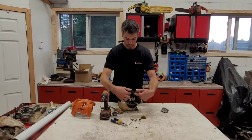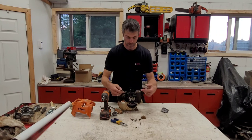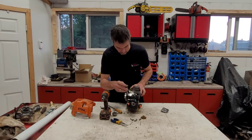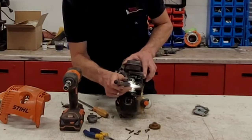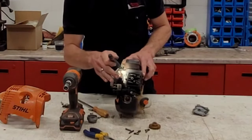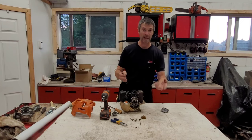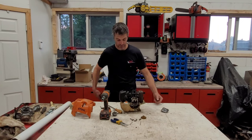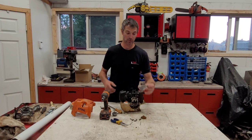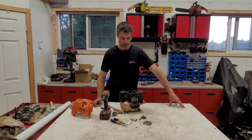You're probably wondering what lubricates the top end. There is oil that comes from the bottom — as the piston gets pushed down it transfers oil up through the cam gear, through the followers, and up the push rods. There's also another transfer port on the intake side. So there is a cycle of oil and gas mixture that makes its way through, oiling everything with whatever oil you've added.